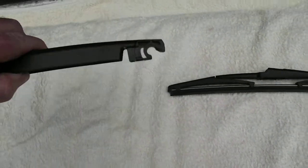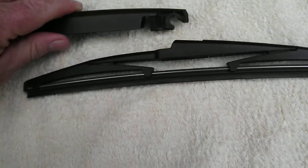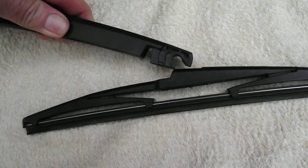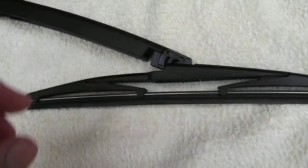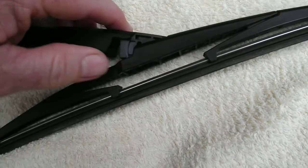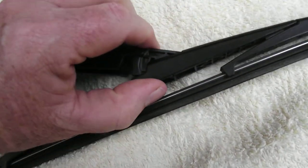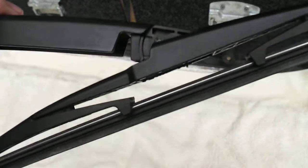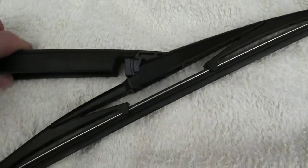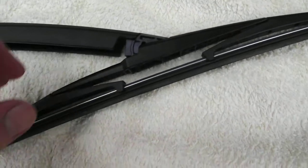What I did wrong and how I broke it: there are some videos of similar vehicles that tell you to clip it back twice when removing the blade. This one you do it once. When you put it together, you click it in - it goes into almost like a little barrel. You can see a channel there, and there are two little lugs in the blade that slide in there, which secures it.